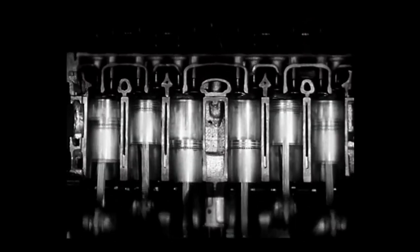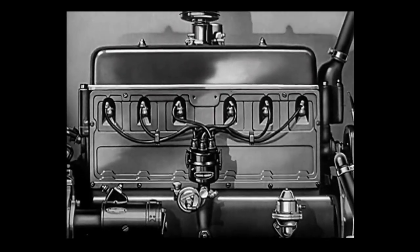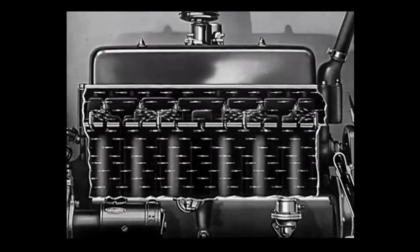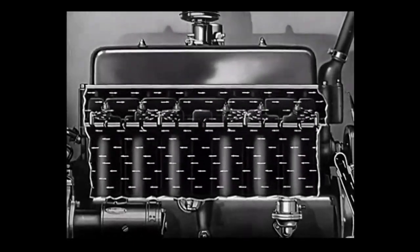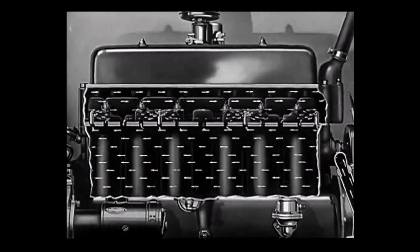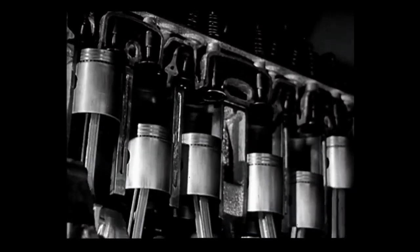In the modern car, all the parts inside the engine get treated to a new kind of cooling. These water jackets run the full length of the cylinder, assuring uniform cooling over the full length of the cylinder wall. This also means that pistons are kept cooler, as they are always running against these cooler cylinder walls. Piston rings and pistons, properly cooled, keep in contact with the oil film on the cylinder walls. Oil temperature is kept down. Cylinder bores remain truly round and straight. All parts run cooler.